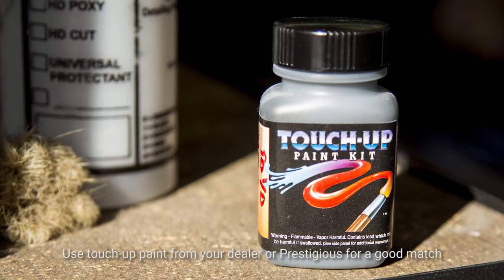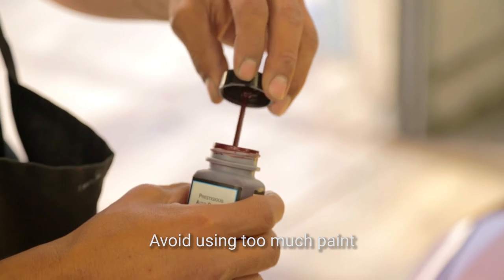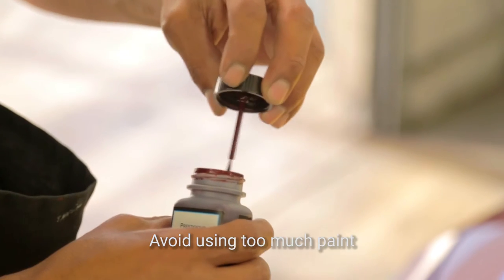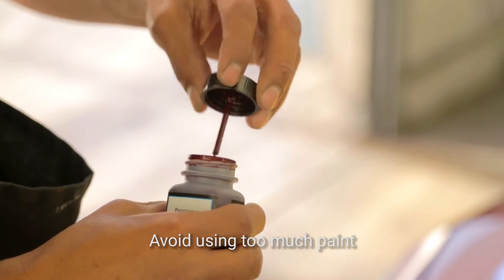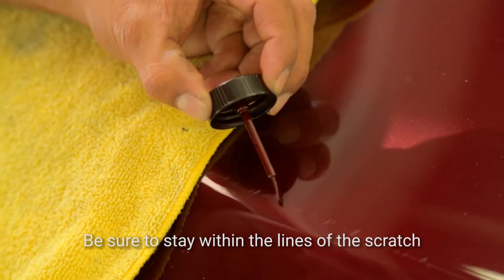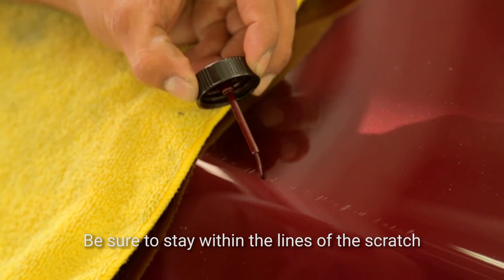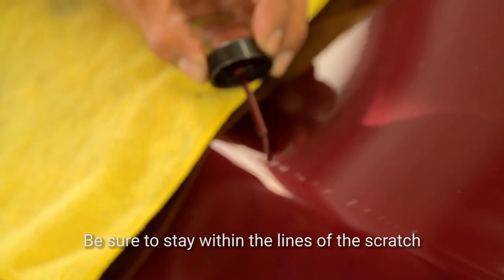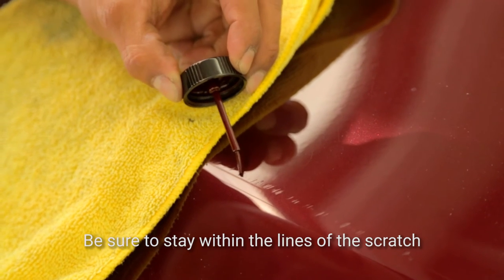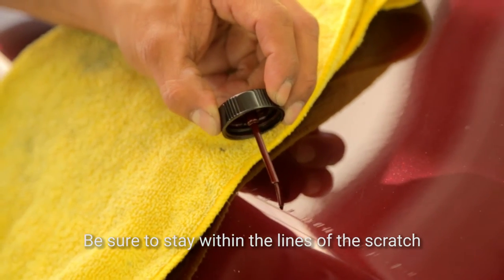We can match up the color for your paint exactly and it comes with a touch-up brush inside, so it makes it really simple. When you're using the touch-up paint, be careful not to put too much on the touch-up brush — you really just want just a little bit of color, the brush to be just a little wet. Otherwise it'll look like blobs of paint on the panel. When you're touching up the paint, remember your first grade teacher told you just to stay within the lines. Stay within the lines of the scratch. What you're trying to do is fill in the scratch rather than to just cover it completely, because then it'll stick out more and look like a blob of paint.